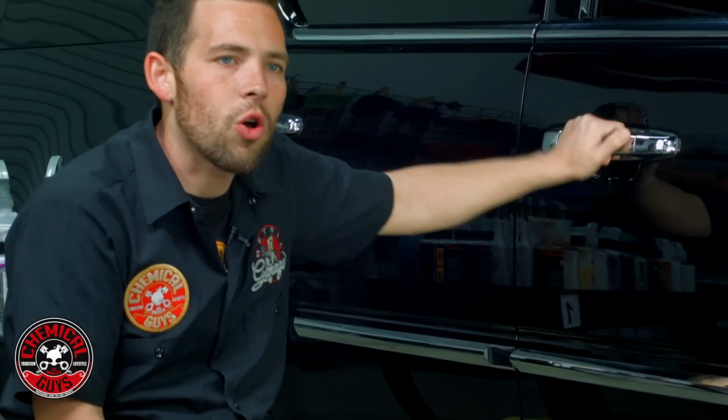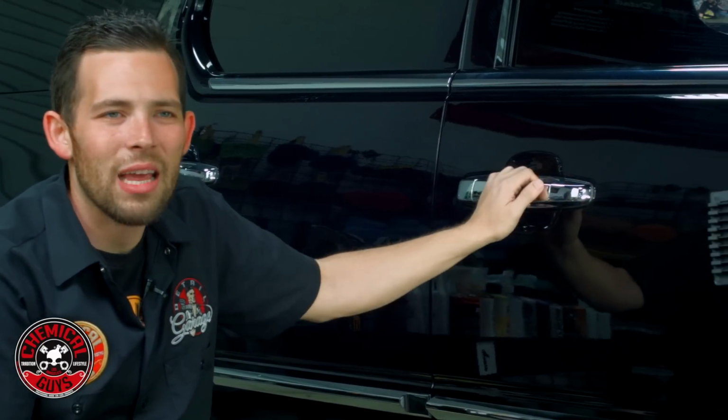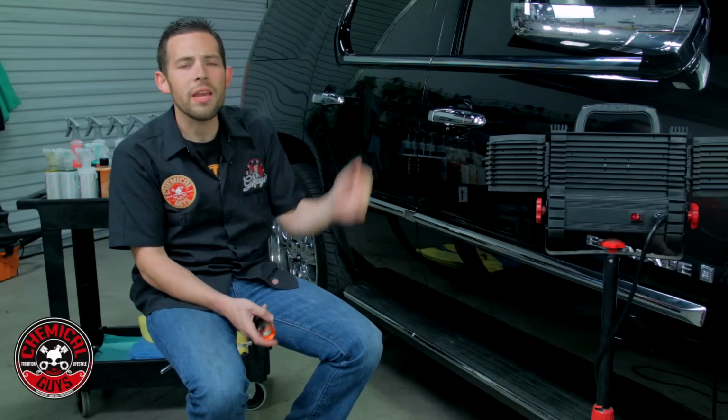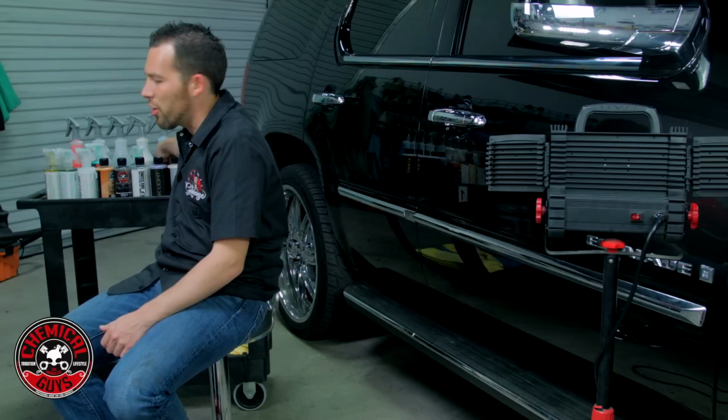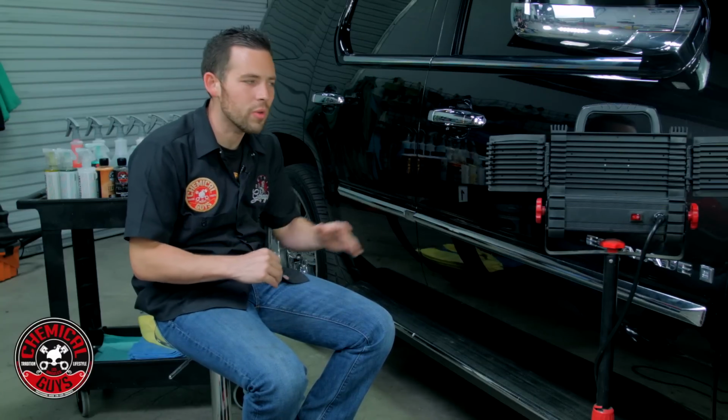Now this paint right here is called a clear coat finish. So it's actually a clear layer over black, and we're going to polish the clear layer to remove all the scratches. Now normally I would do what's called a test spot to determine what type of polishing needs to be done. But I've already done a test spot on the other side, and to keep this video a little bit shorter, I'm going to skip to the test products that I've already used,